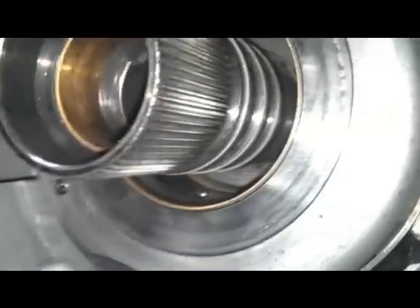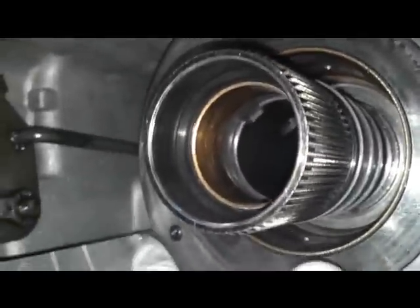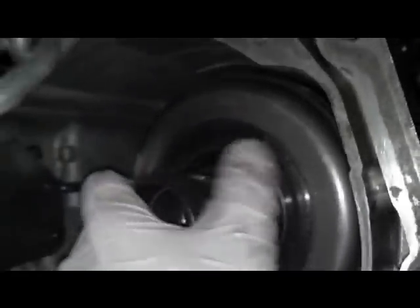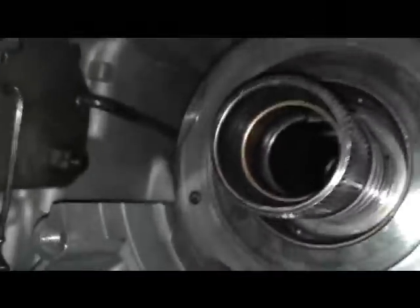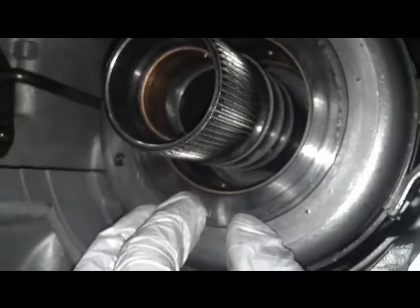To get this seated in — this hub with this little groove here — I got the five-year-old here. Hi Wesley. You hold the screwdriver and that reverse reaction drum to lock it in place, and you spin the center piece and kind of shake it to drop those clutches into place. It drops it down to make it flush. You just gotta rock it back and forth, and I got it to seat into place. I don't know if that's the correct way, but that's the way that worked for me.